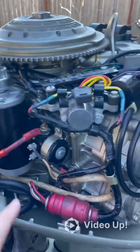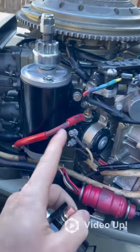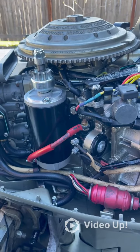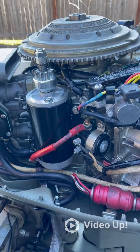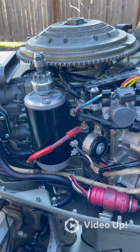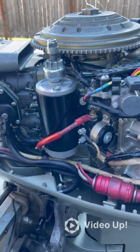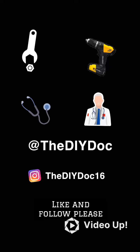If it starts the boat with the key in the on position, that means the solenoid was going bad — it's just clicking and not actually switching over to send current to the starter. That's the fastest way to diagnose a solenoid, and if you're stuck on the water, it's a great way to get home without having to do a pull start or look for someone to tow you in.